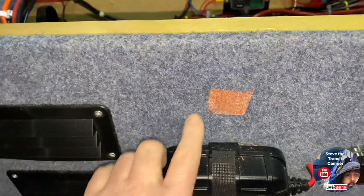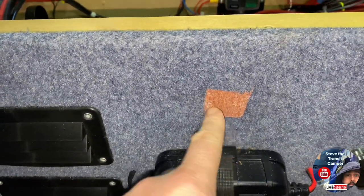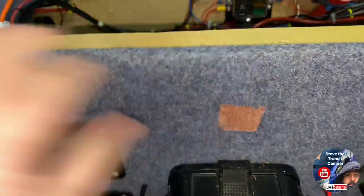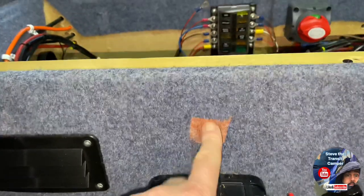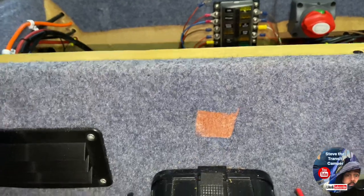So I've cut a piece of felt out, because if you start drilling into felt it'll just twist around and rip the whole lot off — before you know it you've skinned not only your van but probably yourself as well. So I've cut a piece of felt and I'm just going to drill through there.